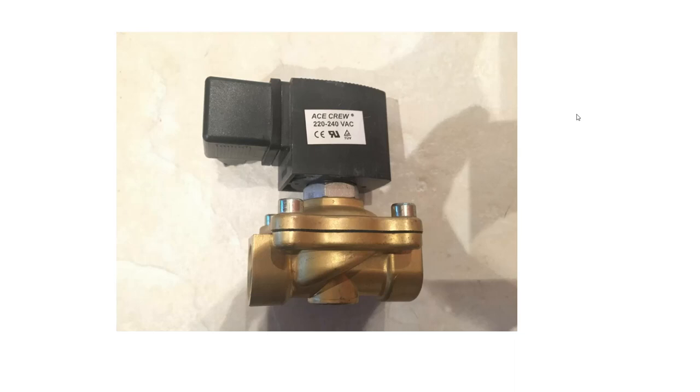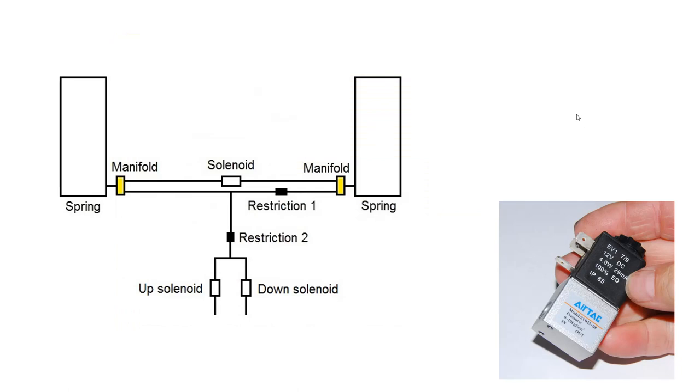This is a half-inch valve; I'm assuming here you're using quite large diameter lines between the extra accumulator and the air spring. Here's how I run the rear air suspension on my car. I have a left spring and a right spring, with a solenoid that connects those two springs together. When that solenoid is shut, the springs are connected but through a restriction, so very little air can flow from one spring to the other. If I open this solenoid by flicking a switch, two things happen: first, the rear roll stiffness is softened because air can flow from one spring to the other — if one side is compressing and the other extending, the air just flows back and forth, reducing roll stiffness.